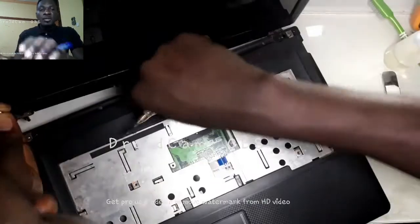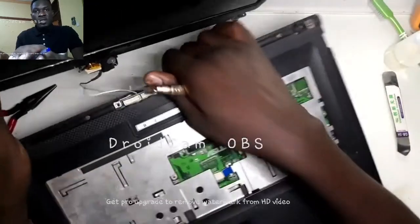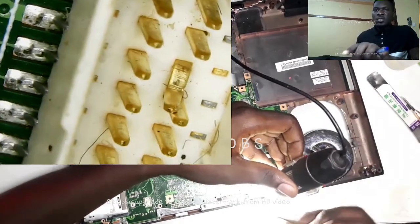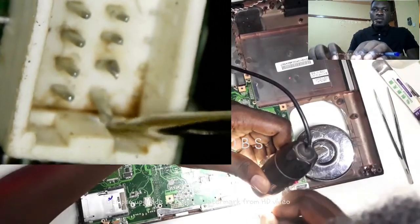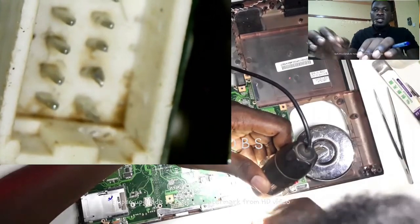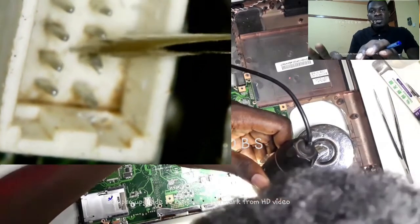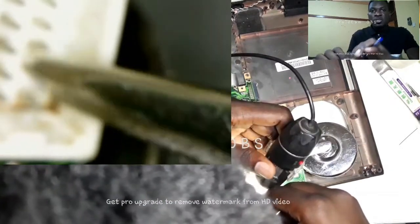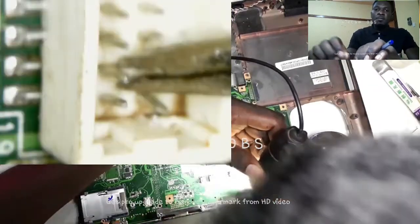I went ahead and disassembled it, and as I was moving the screen from the housing I saw that in the socket where the screen connects, the connector pins were bent. I think a previous technician tried to fix it but bent the screen socket pins when reassembling. That screen socket has 3V, 5V, and 19V pins, and when some of those pins are shorted to ground they can prevent the laptop from booting. I bent and fixed those terminals and tried again — still not working.